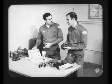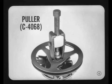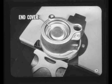It sounds like this should be a real good pump, but tell me, is there something special I ought to know about servicing it? The servicing instructions in the manual are complete and easy enough to follow. However, there are a few precautions that are especially important. For instance, be sure and use this special puller to remove the pump drive pulley — it'll make the job easier and you won't damage the pump or the pulley. Pump disassembly is simple if you know how to go about it. Remove the reservoir and clamp the pump body in a vise with soft jaws, pump shaft down.